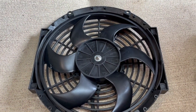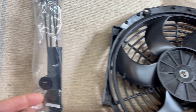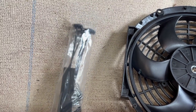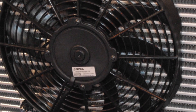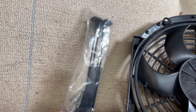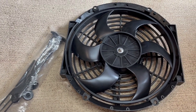The fans that we are using today are churned out in their thousands in China. They come with different branding and packaging but basically they're the same, and they cost around 18 to 20 pounds here in 2022. They usually come set up as a sucker fan, with cable ties for mounting to fit directly onto the radiator, and some have instructions that state simply reverse the polarity to make this fan into a blower. That is not correct, as you will see in a moment.